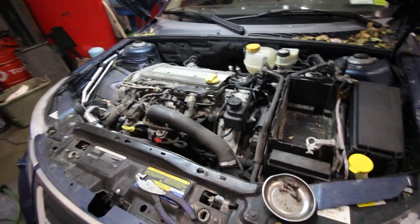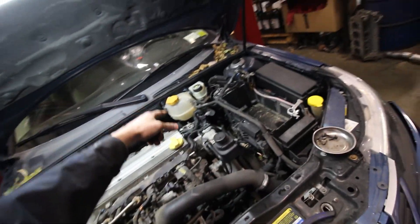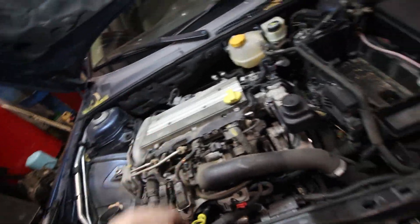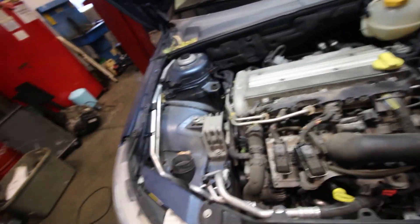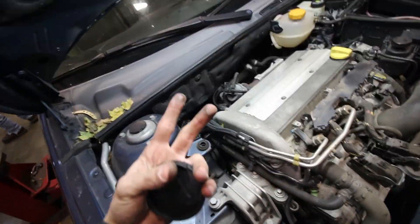So this is how to fix that. It's an expensive fix, but you put new valves in and it's like a brand new car. So I got the intake and the inlet tube off the turbo, drained the coolant, got to drain the power steering fluid, take off the power steering pump, vacuum pump, fuel rail, wiring harness, tubes - all sorts of tubes. Pretty much this is a pretty easy job to take the head off. Remove everything, pull the head off - it's almost a two-step process.